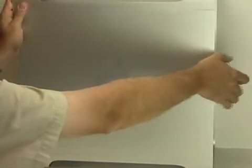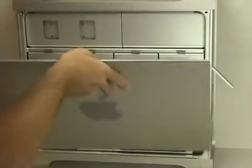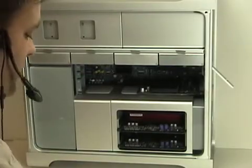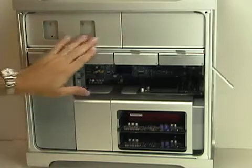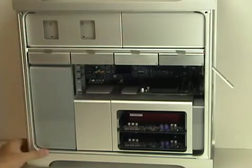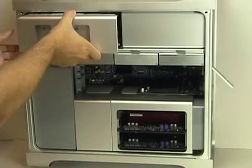I'm going to show you how to install a second optical drive into an Apple Mac Pro system. Apple has made this process extremely easy. All you need to do is remove the side door on the Mac Pro. Up here you can see this is the optical bay. It already has a factory SuperDrive installed from Apple — they chose to use a Sony unit. And I'm going to install a Pioneer DVR-111 drive.